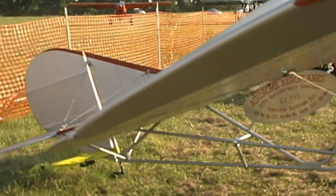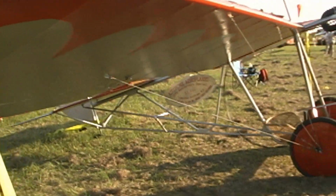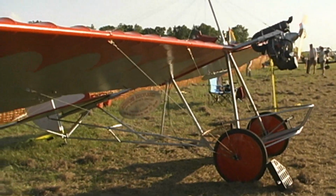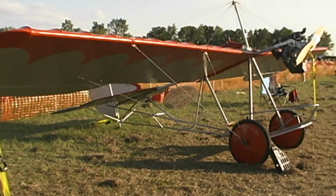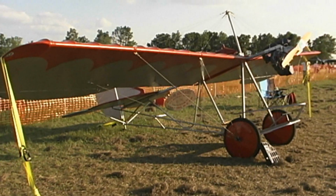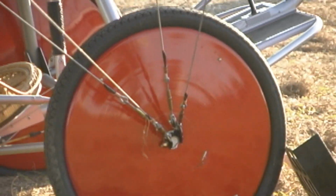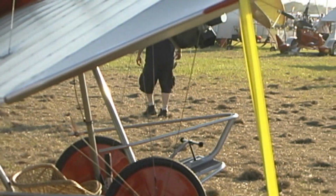Fantasy. This particular airplane with the 277 Rotax weighs 226 pounds. Equipped with a 447 and things, it'll come in at about 238 pounds. So this makes the Part 103 ultralight category with plenty of room to spare. A builder doesn't have to be concerned with just a few pounds here and there putting them out of the weight limit. Now, the airplane kit, is it something that is going to take a long time to build?